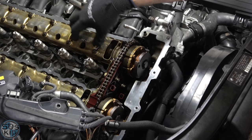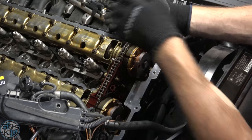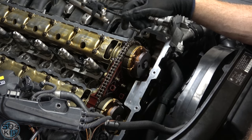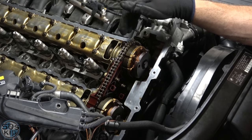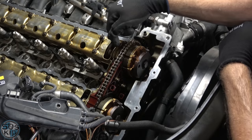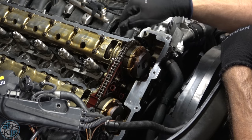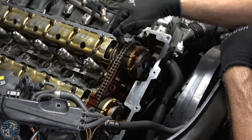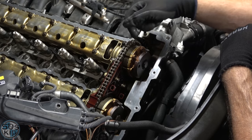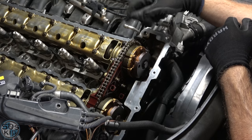This whole clamshell on top contains all the bearings for the cams — there's a top and a bottom clamshell and you have to replace the whole unit. The way you know if this is the case is to disassemble and open it up. You'll see the areas where the steel cut o-rings ride, and you can run your fingernail over them. If you feel a distinctive ridge, it's time to replace it.